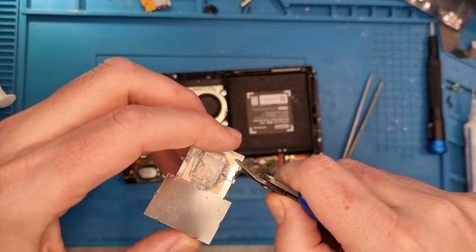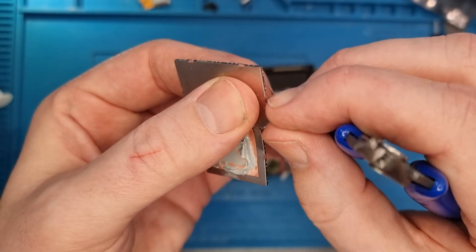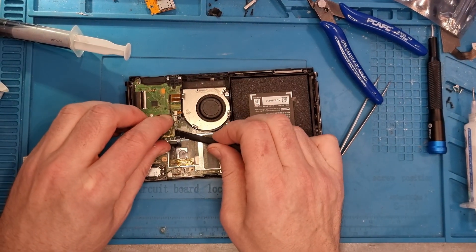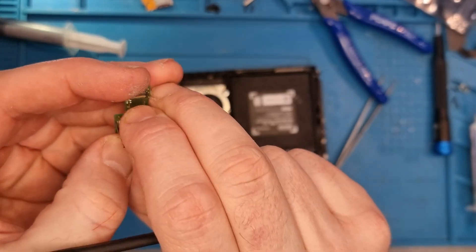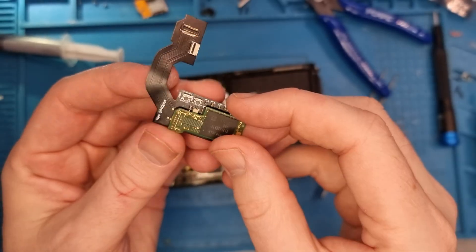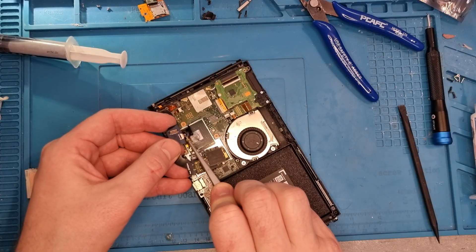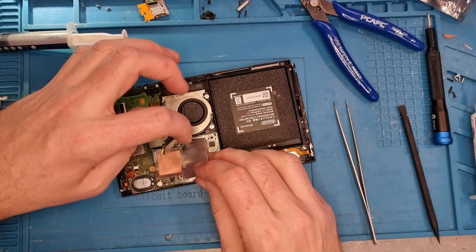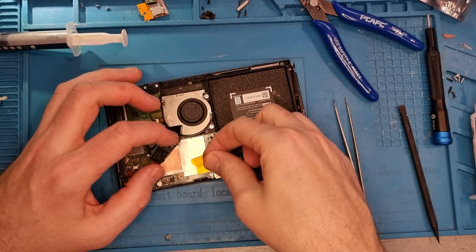We just need to get the shield back. Some people will cut this, but what I tend to do is just bend these top tabs out, then bend the side tabs that you've bent out back into place. Clean it up and apply new thermal paste. Carefully pry off the film from this heat shield with a plastic piece. Then we'll put that back, get the modchip — the ribbon cable just needs to bend back, goes into this connector, folds across and clips into place. Then we can pop the heat shield back in there, making sure you don't trap any wires. As long as you've bent the tabs out and back, it will go into place.